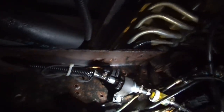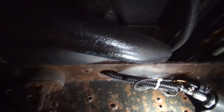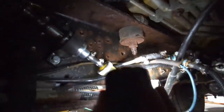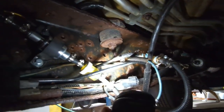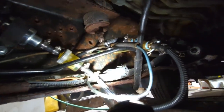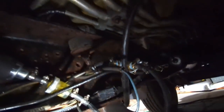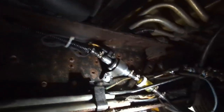From the T-fitting tap, the line goes into a little fuel filter, and then out of the filter into the diesel heater fuel pump. It's critical that the fuel pump is mounted at an angle pointing upward — at least 15 degrees. From there it goes in its split loom jacket up inside to the diesel heater. The parts you'll need: that soft braided fuel line is five-sixteenths inch inside diameter. Get five-sixteenths inch barbed fittings, put those into a tee, and off the takeoff of the tee use a one-eighth inch barbed fitting — that should work with just about every brand of diesel heater.